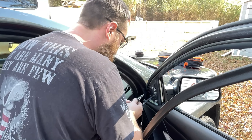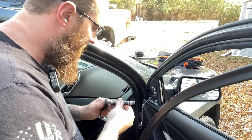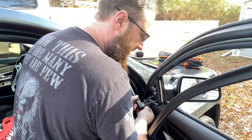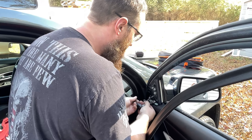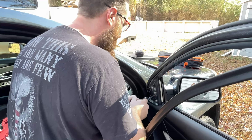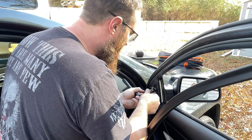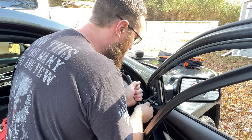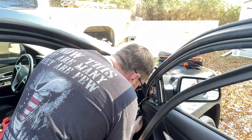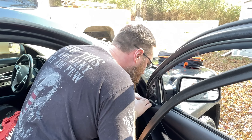That's a pretty straightforward process — not too bad. I did pull the wire back from the door panel; it had a little clip holding it into the door, but getting that back on would most likely require taking the door panel off, which is a bigger process, so it'll be all right. All you need is a 10 millimeter socket and a soft plastic pry bar — really only two tools to do this job. Make sure you get your wire clip back in and behind the door panel so it's not going to be in a bind.